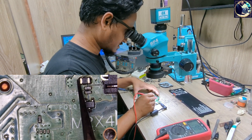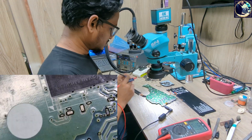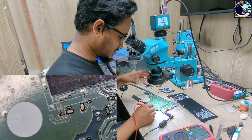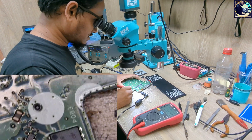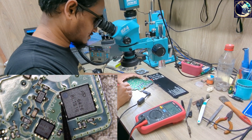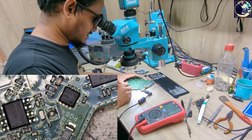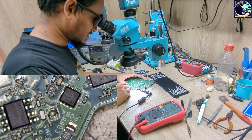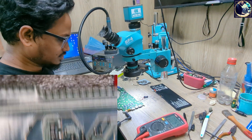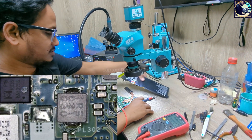On the other side we also have 19 volts. Let's flip the motherboard and check these two MOSFETs. We have 19 volts on the other side as well — that's okay. Check the gate pin 25, also okay. Now check the current sensor resistor — I have 19 volts. So this side is good.